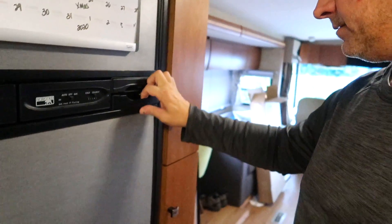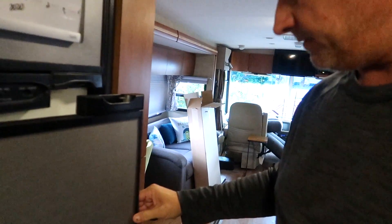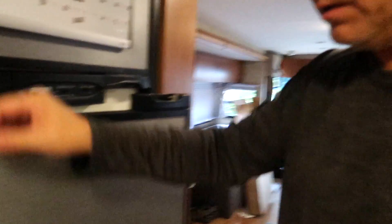The hinge hardware is pretty straightforward — there are just two pieces, one for the bottom of the refrigerator door and one for the bottom of the freezer door. The freezer door doesn't take a lot of load, but I'm going to install the reinforcement hinge there too. It basically just clips into place and there's a washer you use as a spacer. It really just takes a flat blade screwdriver and a Phillips screwdriver. The hardest part is taking the door apart, removing the handle, the trim piece slips off, the door panel slides out, and then the door just lifts out.